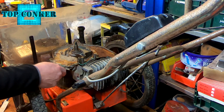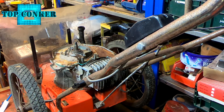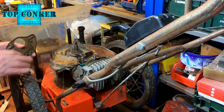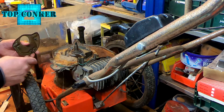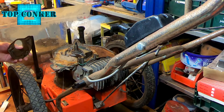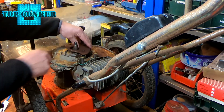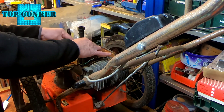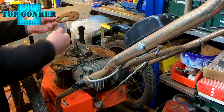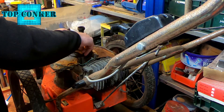This plate I took off just to see what was underneath it, and frankly there isn't anything underneath it. What is there is the crankcase breather cover — here it is — that needs to go back on. I've checked the seal; apparently Ken Small Engines told me these tend to have the upper seal go on them, but this one looks perfect. There's a bit of sponge in there which I'm not going to touch because it looks genuine. This just basically sits down on there and there's a seal there — it is sealed after a fashion — so I can just pop that back on and screw it in place.